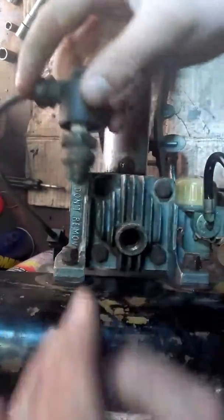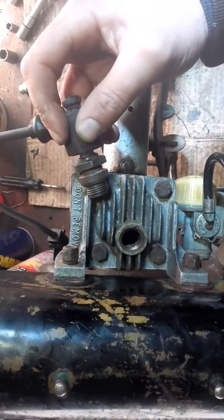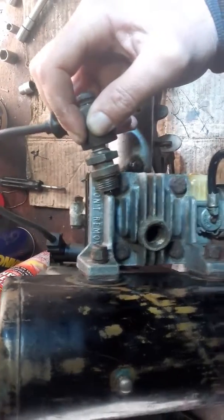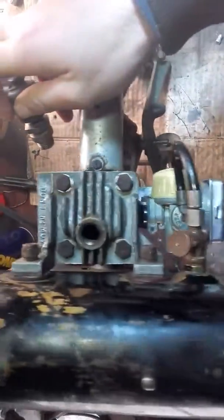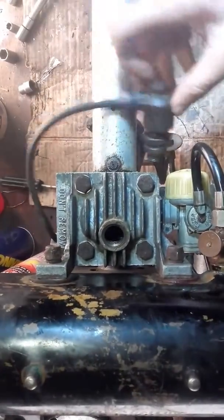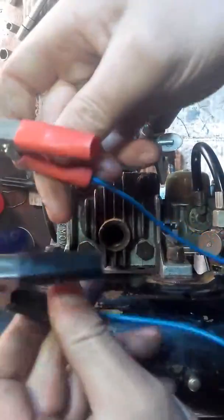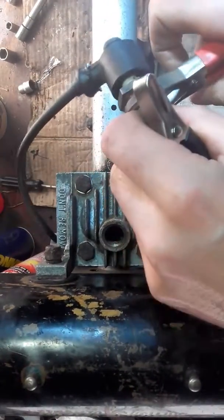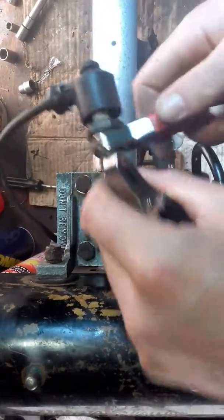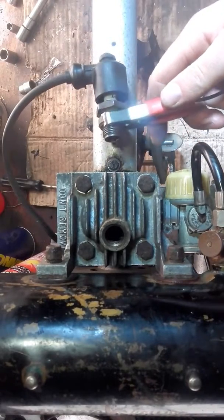For this, you could probably hold it in this position and get away with holding it here and spinning it over just like that. You can see that it's sparking there. What I've made up is two crocodile clips together with a bit of automotive wire, so you can relax and when you're spinning it over, you can hold the seagull leg and spin the flywheel with your other hand.